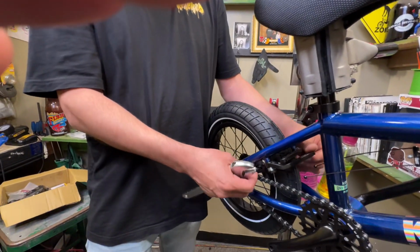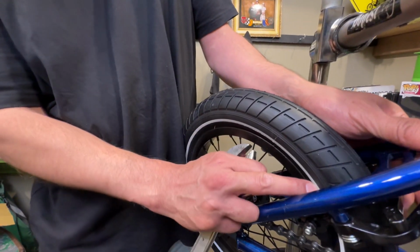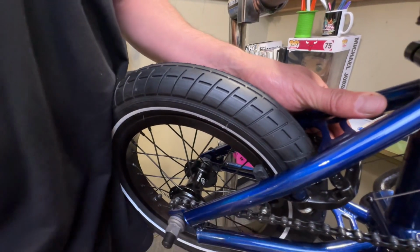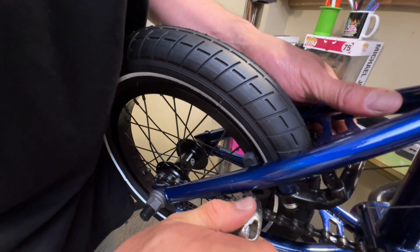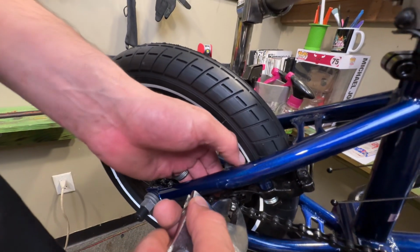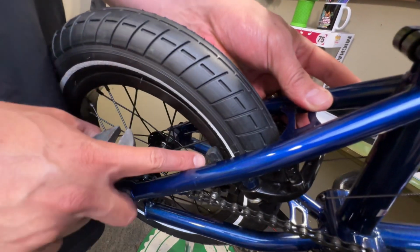On the opposite side, you want to push up the arm and then place this pad onto the rim and make sure that the pad lays flat. If you jiggle it around like that, it should make it lay flat, and then you'll get the best surface to surface contact. See how it rotated a little bit? Hold the brake pad and then rotate the brake pad and then turn the wrench a little bit too to get it to line up.